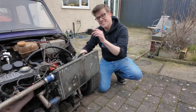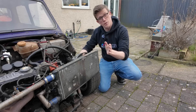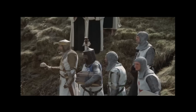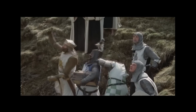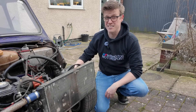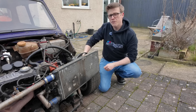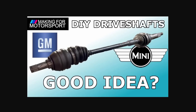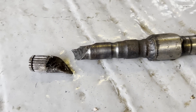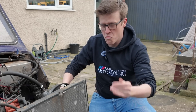Next problem is the drive shafts. As it stands, they're not straight. I couldn't get the engine far enough back, so they come into the CV joints at an angle. So there's a limit to the amount of steering lock I can put on before the CV joints instantly turn into grenades. Not good. And speaking of the CV joints, they're made for about 60 horsepower and skinny 60s rubber — not meant for 100 horsepower and modern wide tyres like we've got here. And finally on the drive shafts, you may have seen the video where I showed how I make my own, where I weld a bit of Vauxhall shaft to a bit of mini shaft. Well, even my welding turns out is stronger than a mini drive shaft. These are the primary cause of me not finishing events. Got to be changed.